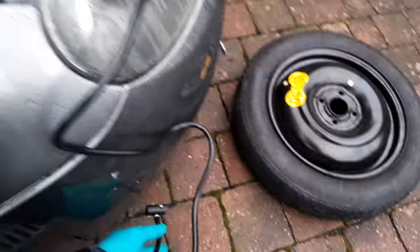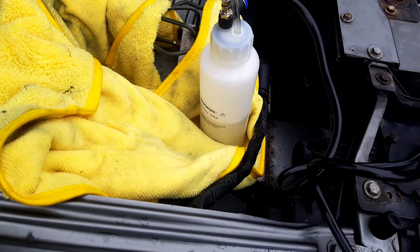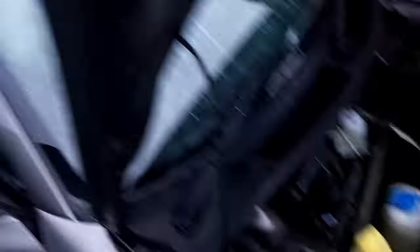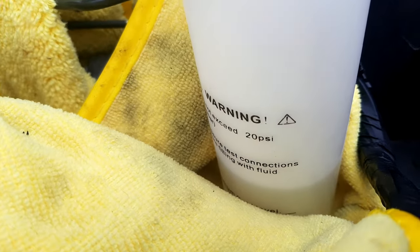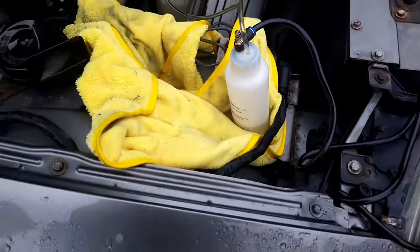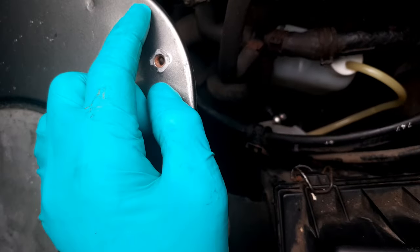We know where the fluid level is, so now I'm going to press this onto the tyre to push the fluid through. The nipple's undone on the back, so the level should go down. Once we've gone to about halfway to the minimum, I'll lock it off and let the pressure off — hopefully the non-return valve at the back end will stop it coming back. Let's keep going until the minimum and try to get any air bubbles out of the system. We saw a reasonable amount came through, I locked off the nipple, tried the clutch pedal — and nothing, still nothing.